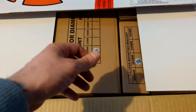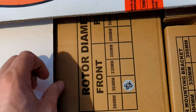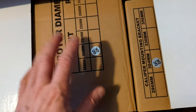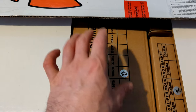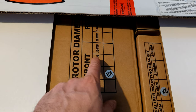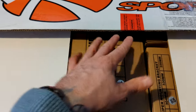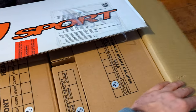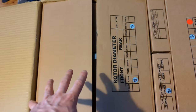I've already opened this up just to check — this is for a car with 16-inch wheels. These are 304-millimeter two-piece rotors, which helps with weight and venting. I initially ordered 330mm but realised my wheels were smaller than I thought, so I had to go down. I don't know if these will actually fit yet because my car is still out having its engine completely rebuilt — a fully forged SR20DET for the Nissan Pulsar GTIR.